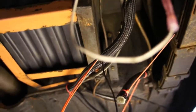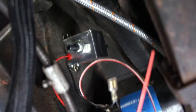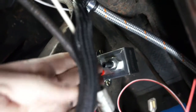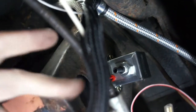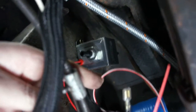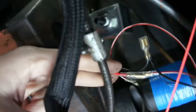I just have to get them mounted, figure out how I'm gonna run all my fuel lines, and do some cable management to make sure everything looks nice and is out of the way. Here's a shot of the wiring for the two pumps — I got the pump mounted right on the side of the battery box and I've got some little rubber feet underneath it to reduce vibration. One of my red and white wires goes to the SU pump positive in the back.